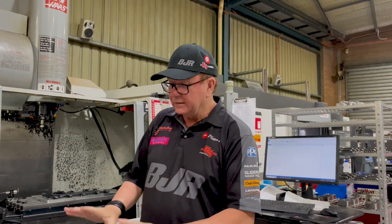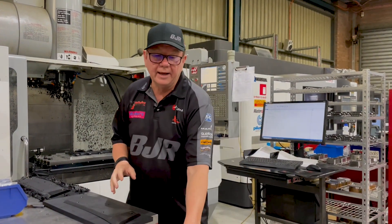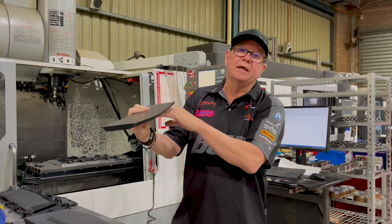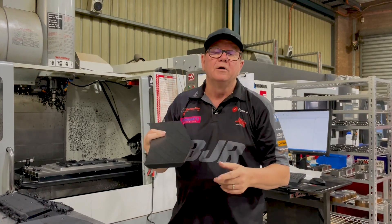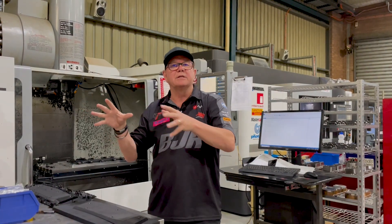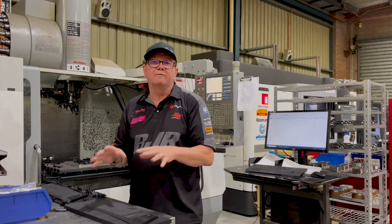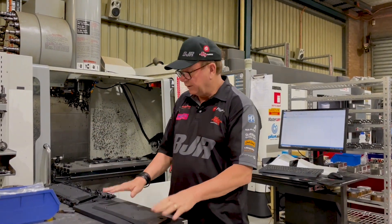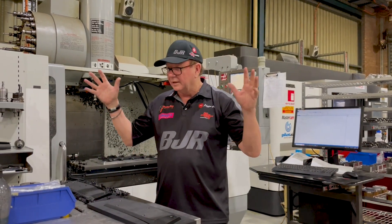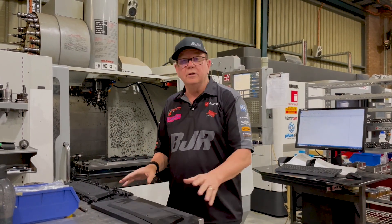The reason is because when the car is at massive braking and the front is hitting on the ground, if that's close to the ground, not much air can get under it, so the air is forced to go around the bumper, which on these Gen 3 cars tends to make the rear of the car unstable. So by allowing some air to go through under the front, it gives good stability under braking. They felt this would really help the Mustang the most, and because we're keeping the cars as similar as we can, both cars get it — and it'll help the Camaro as well.